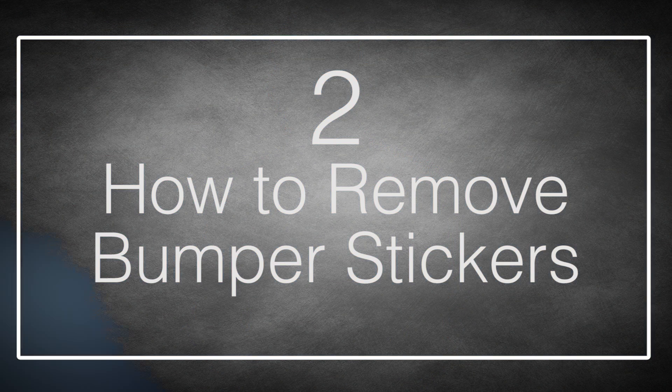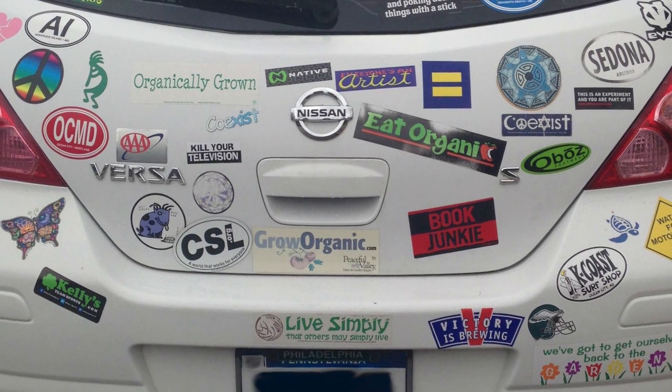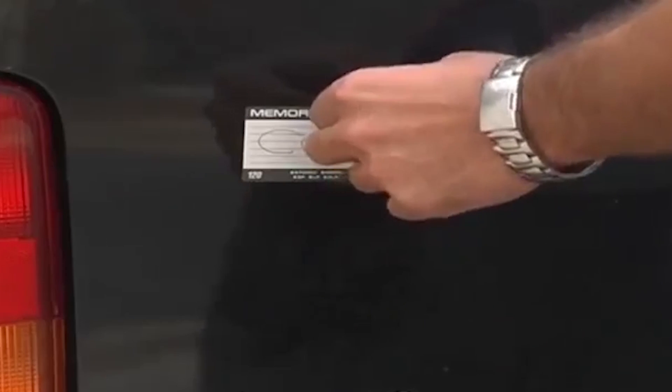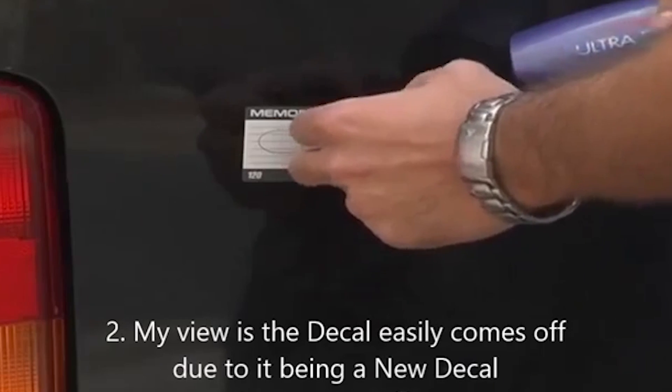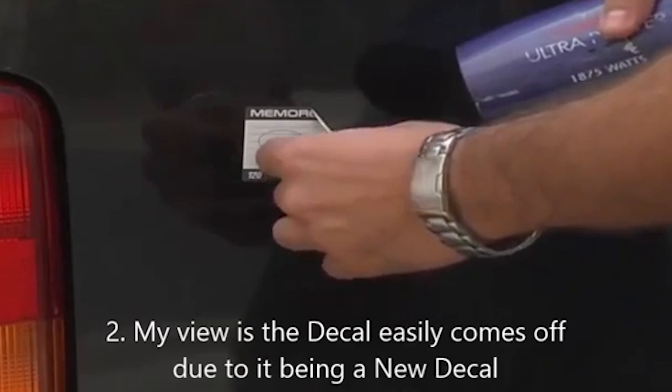Number 2: How To Remove Bumper Stickers. Bumper stickers can be kind of like tattoos — at first you may think they're awesome, but a few years later they're still around and not as great or as relevant as they once were. To remove a bumper sticker or decal, just get a hairdryer and set it to a low heat. Put it about six inches from the bumper sticker — don't hold it any closer or the paint could chip — and heat up one end. When one of the corners starts to become unstuck, grab it and peel off the sticker slowly while heating up the rest as you peel. Once the sticker is off, any remaining flecks of paper can be scraped off with a rubber spatula, then wash with a warm cloth. Another trick is to pour boiling water on the sticker several times, or put a rag soaked in boiling water on the sticker, which should cause it to peel off without taking the paint off your car.